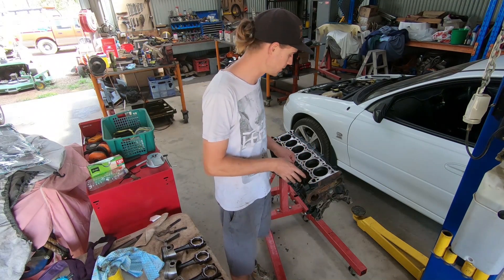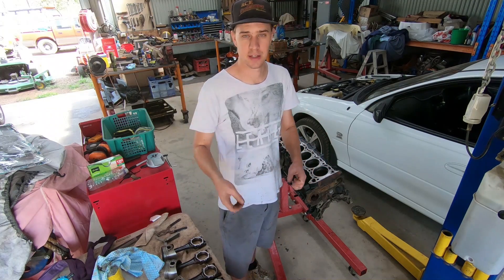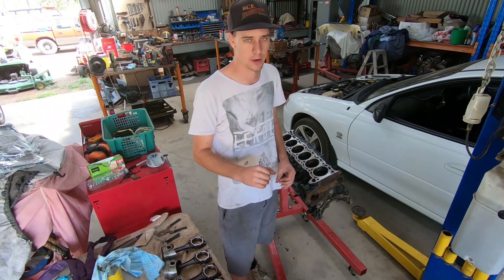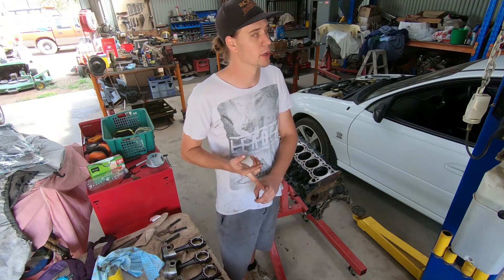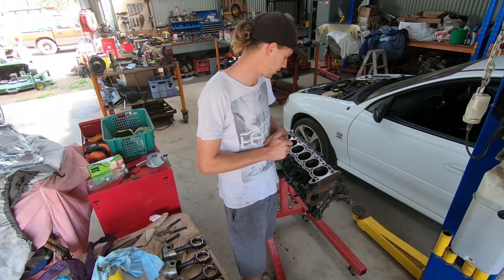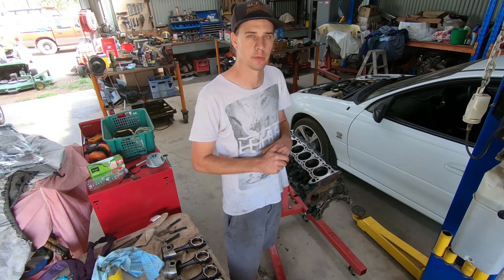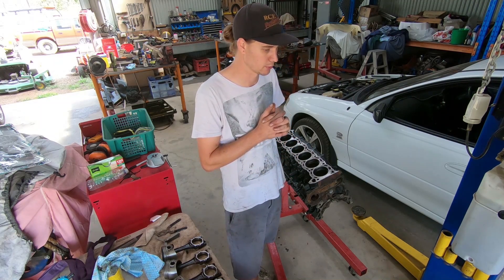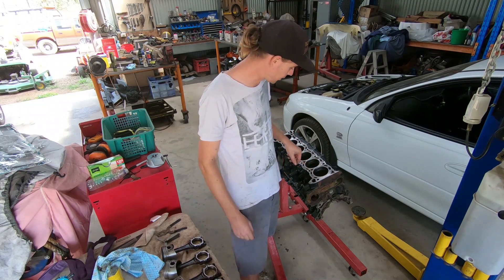That's a lot better gap than 0.8mm. The rings that came off these pistons are going to go back on them - I am going to open them up a little bit more to about 18 thou, given it's going to be a boosted motor with high compression pistons. I'm not going to use the rings that came off those turbo pistons because there's way too much gap - I'd end up with blow-by and burning oil issues. I really believe someone just messed up and gapped them to the wrong specs. So I'm going to go ahead and gap all these other rings now.